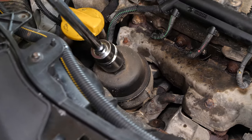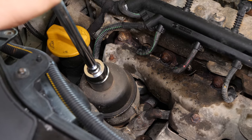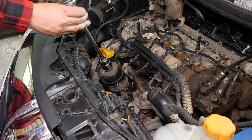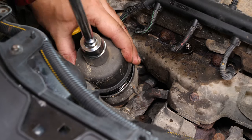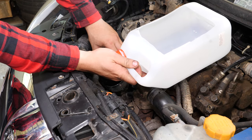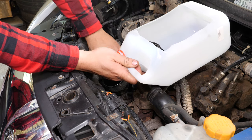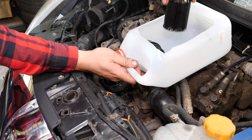You can now access the filter flange. Take a socket wrench, an extender and a 27mm socket. Release the flange by unscrewing it in an anti-clockwise direction until it turns easily. Finish the unscrewing process by hand and remove the filter. When it comes out, leave it to drip for a few seconds, then take it out of its housing and turn it upwards. Place it into the liquid collector so that it doesn't drip oil in the engine.